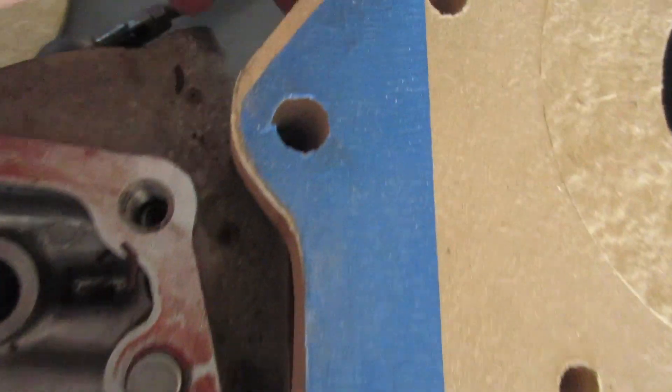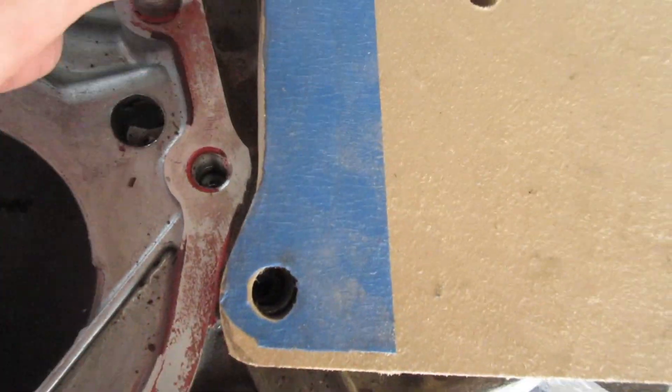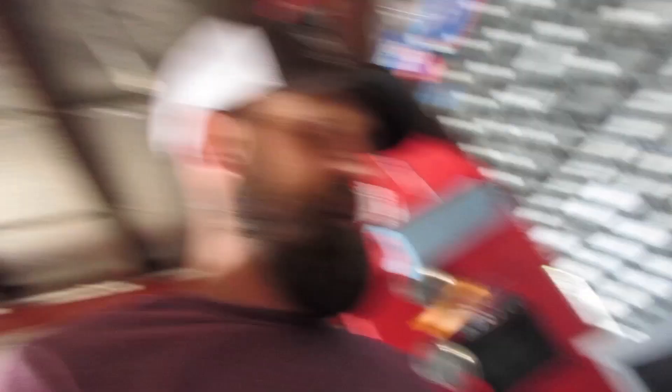This side is fine — it actually took off more than I needed there, but it now hugs the line nicely. I've found in the past that two pieces of metal that are flush are not fun to get off — you end up having to wedge a screwdriver in after it's stuck together to bang it out. I'm actually going to leave the lip so I have something to bang on to get it off.